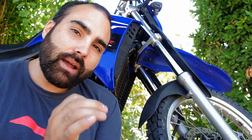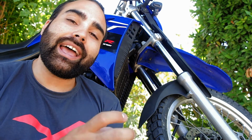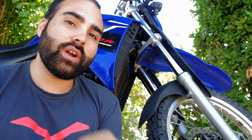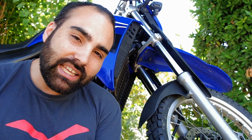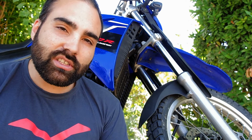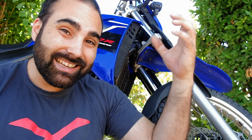My top tip and my best advice is, before you go on your adventure trip, change that seal into a new one and have a reinforced seal. It's completely different to ride with reinforced seals than the original seal that comes with the bike. It's very different to have a little leak or a running leak. A little leak, well, drive slower, try to hit less things, drive more carefully, but you can drive. If it has no oil, if it's completely dripping down, then you have a problem.